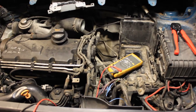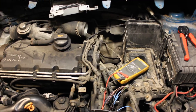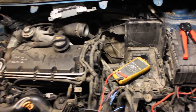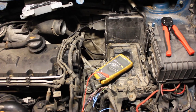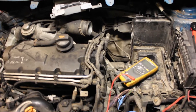Hey folks, this is just a quick video on the camshaft position sensor on a Volkswagen 1.9 TDI PD engine. The issue I was having with this vehicle was a code 19463, which is camshaft position sensor G40. G28 is your crank sensor, G40 is your camshaft.